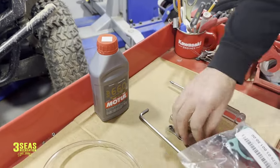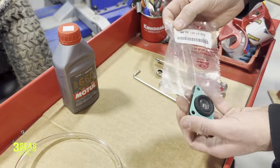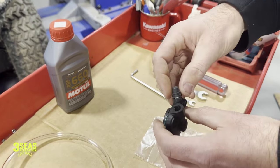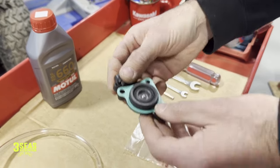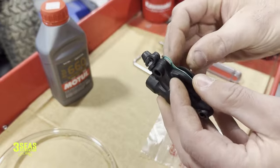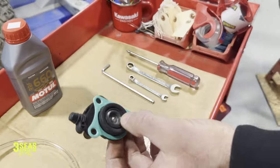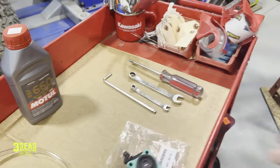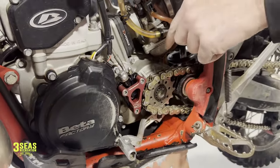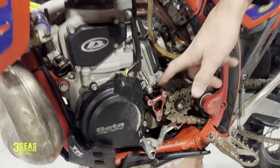If you call and want to order parts for your slave cylinder from me at 3Cs, I'm just going to sell you the whole kit because I think it's like 60 bucks. It comes with the gasket, the new cover, the bleeder screw, everything. What fails is — there's a seal on the inside of this — and that's what fails on these. It lets your clutch fluid seep out and it ends up going inside the transmission because this passageway goes into the other side of the motor into your gearbox oil. So if you're losing your clutch halfway through a ride, it's probably because your seal is failing and you're losing your fluid.